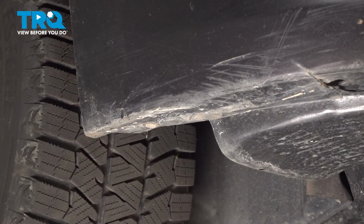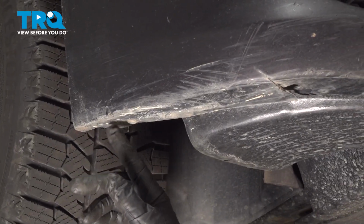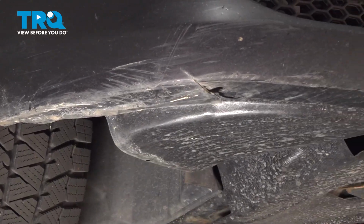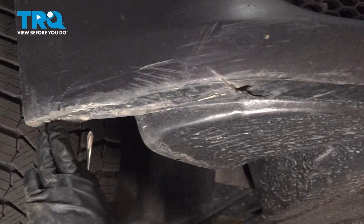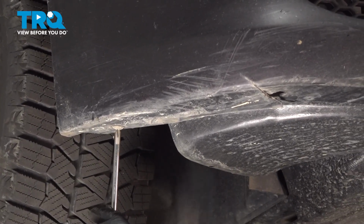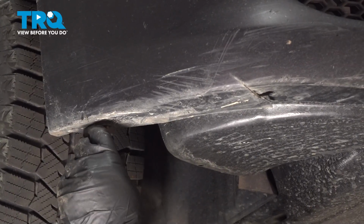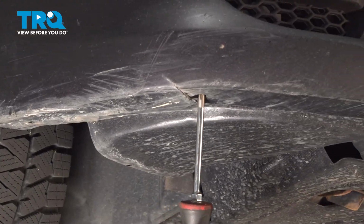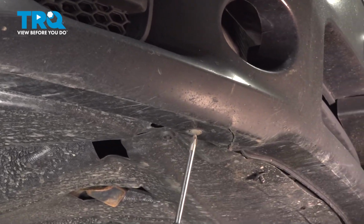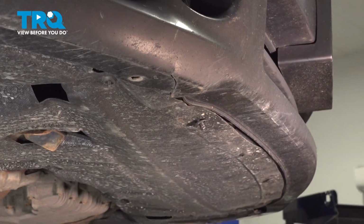Now from under the vehicle, you're going to find the bumper cover and go all the way over to the tires, and we're going to disconnect anything that connects underneath straight across. They should be identical on both sides, so that's probably 2 or 3 Phillips head screws, starting at the wheel well and going forward. So one there, one there. Then all these clips going straight across.